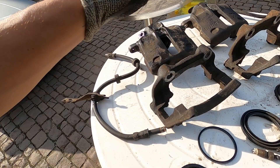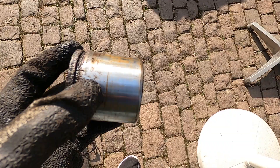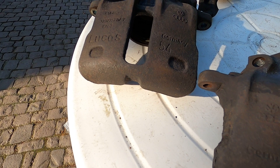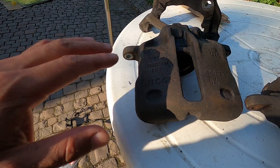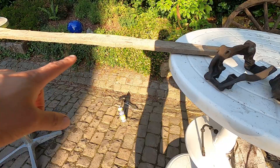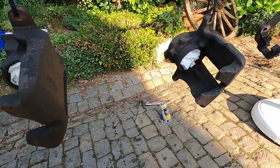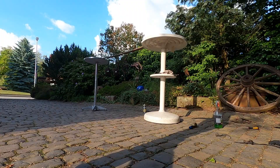These actually look pretty clean inside — not really any rust, so they should have been in fully working order. We'll do a nice rebuild and make them brand new. Even the pistons themselves are pretty clean with just a little rust at the very top. After some good old brake cleaner and a wire brush, these things came out super clean. Now I'm going to hang them all so I can spray all angles and get nice coverage before the first layer of primer.